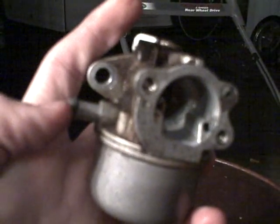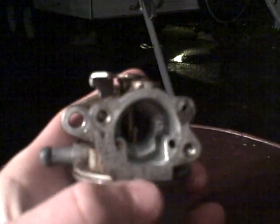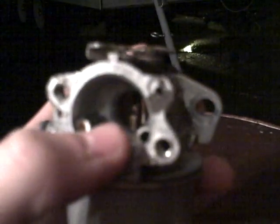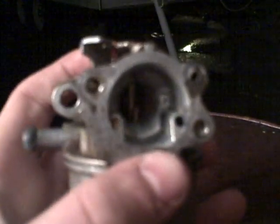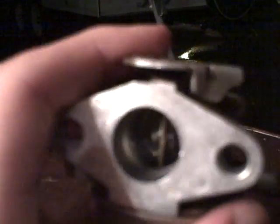What's important about all this airflow speed is that little needle-looking thing in the middle, which lets the fuel come up from this bottom portion here where the fuel reserve is held, coming in from this fuel input right here. When the air comes in from the air filter, it's accelerated by the little bump in the middle — it's called a venturi — and that creates a vacuum that sucks just the right amount of fuel through the needle and out the other side.